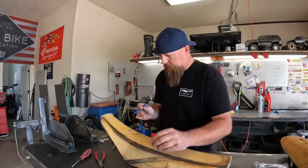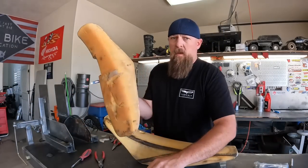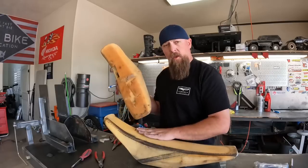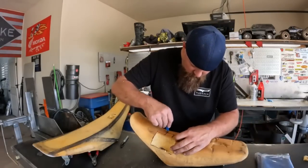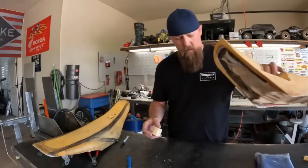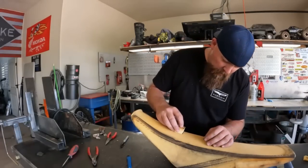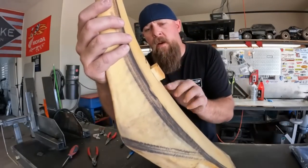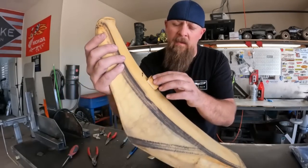See, kinda like so. I'll flatten out the inside of that so it's square. Take that piece, transfer it over to that one, cut a section out that's a little bit taller than this one, glue it in, we'll shape it, be done. Kind of like cutting the cake out of the middle. Trim that up to fit, glue it in. We'll trim that off and I'll sand that down so it's the same profile as the old chunk, just like it never even happened.